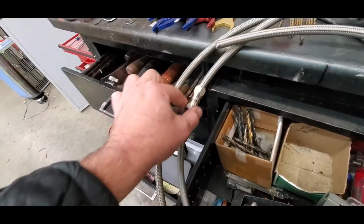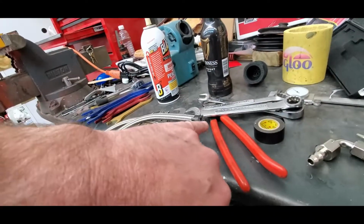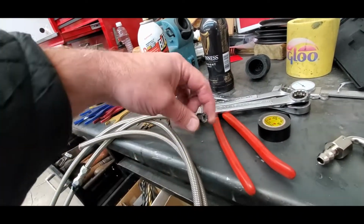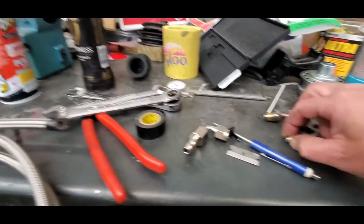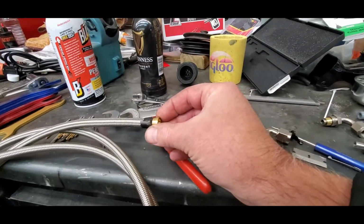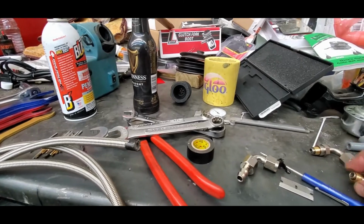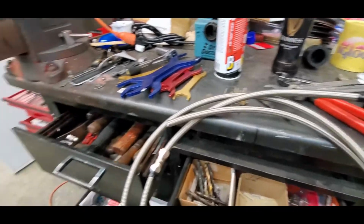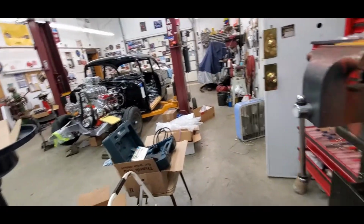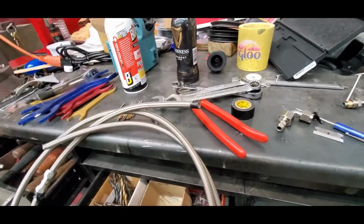Okay, I've already got the back shells on. And then I've been taping them, taking them over to the chop saw. And then I take a razor blade and clean the PTFE off. And then we peel that off. And then this little olive here gets knocked on. And then this gets inserted inside the PTFE and pop them together. It's not that it's hard, but I remember why it was so difficult in the rocket ship working on the floor with hand tools. Didn't have a fancy saw for cutting them back then.